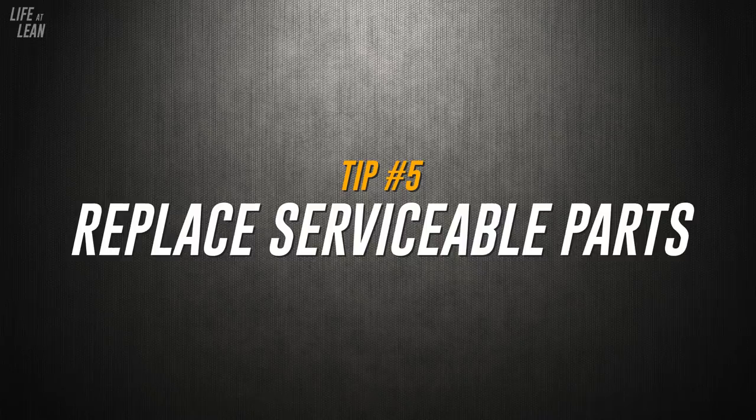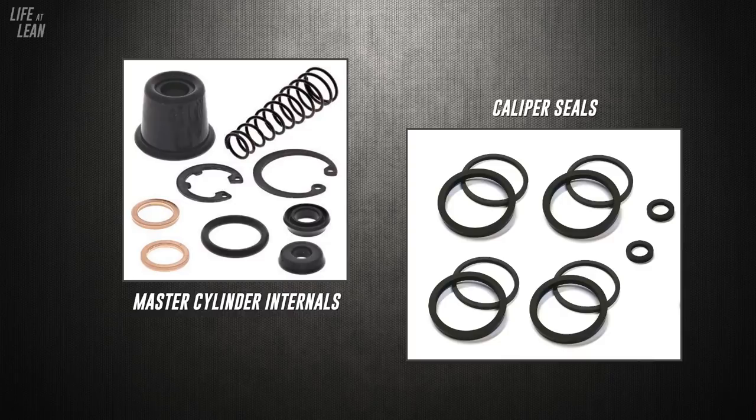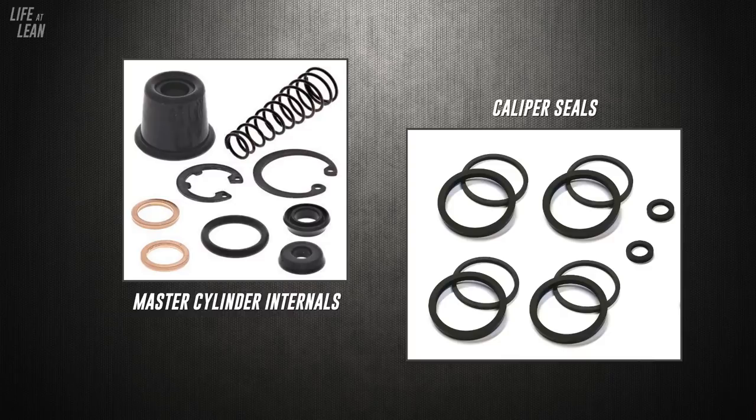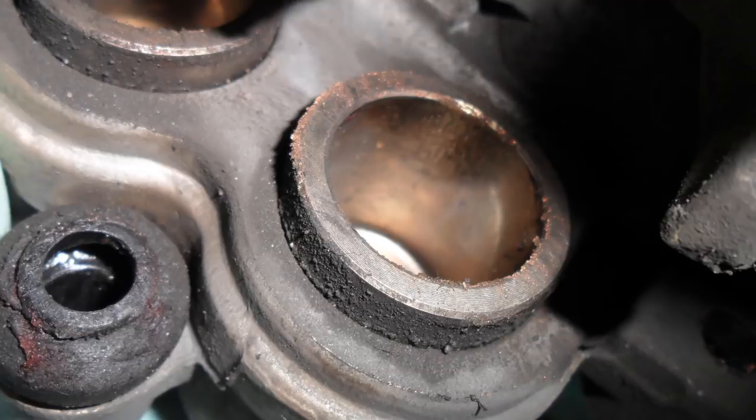And finally, tip five: replacing serviceable parts. While not really an upgrade to the braking system itself, like tip number one, keeping up with the maintenance schedule and replacing system internals or cleaning non-replacement parts is an important part of making sure your system is up to scratch. Rubber perishes over time, so the seals inside the master cylinder and inside the calipers will degrade and lose effectiveness. Dirt and particles can also build up around the piston and cause them to stick. In the end, the pads will drag on the disc because the pistons can't fully retract, and this will only further produce unwanted friction and heat. If your brake system isn't kept in good working order, it will affect the performance of that system.